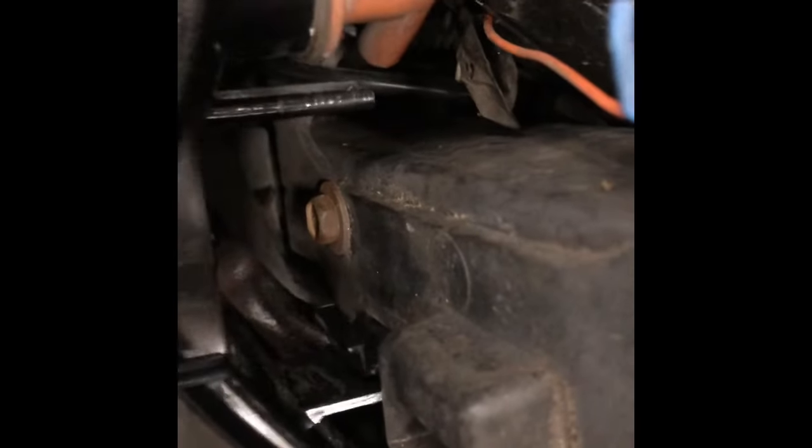Okay guys, I was putting the bumper lights in and I ran across a problem. I solved it now, but I just want you to know, I'm trying to give you my best review possible with these lights. When I was clipping them in, I put in this corner clip, where you slide into the side and you have this other clip, this one right here. This clip that they put on these doesn't spread out enough, so whenever it clicks in, it doesn't click in like it's supposed to. When I plugged it in, it's really loose, it just sits there, and it comes right back out. It doesn't click.